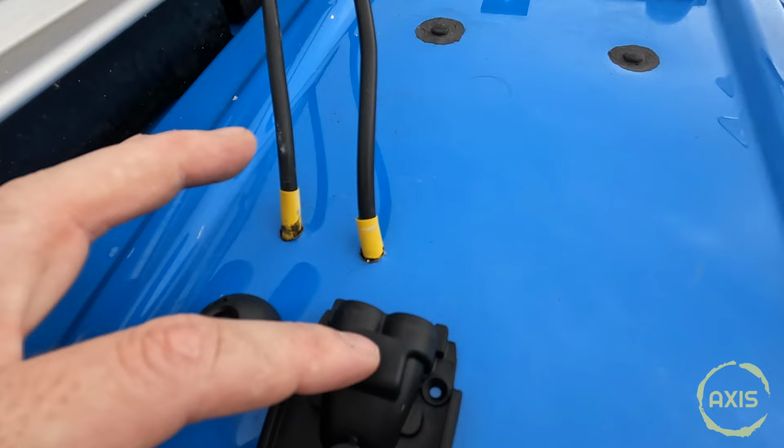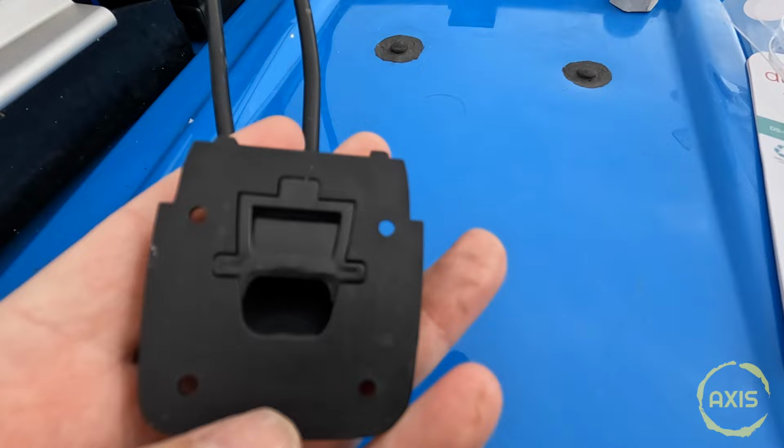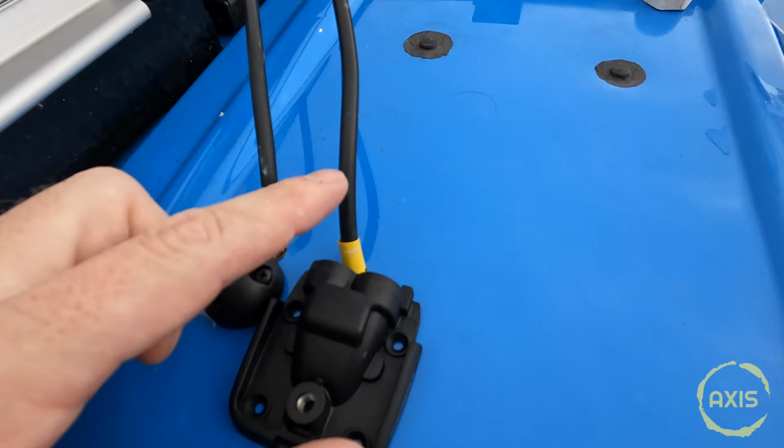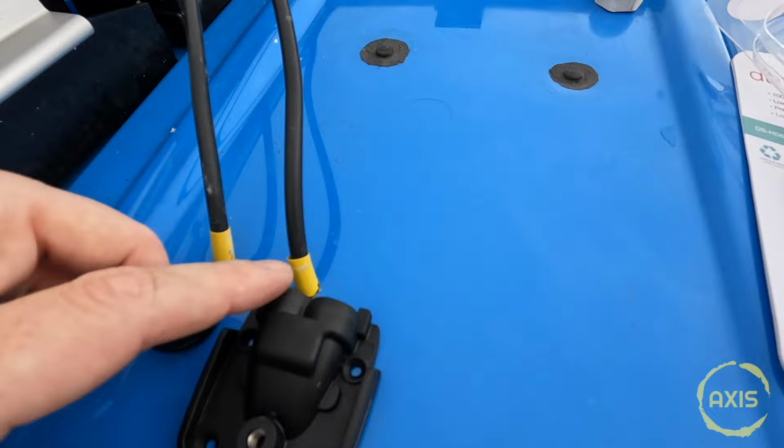What I might do is, depending on where the hole lines up on that, see that goes straight to the centre, is if we can get that in on that cable, and I'm wondering whether that will squeeze down the side of it. So then what I can do is, the solar wire can go through that one because it's 6mm, and then this solar wire can go through this one, and then the LED can come through that section. So I need to blank that one for the minute, because look over there, that is black as anything.